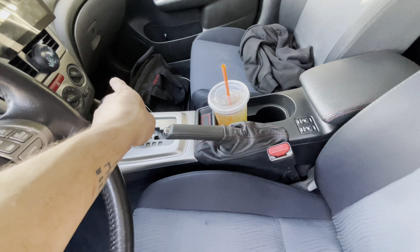I did find the break - it's back here. You can see it's like burnt. I have two halves of the wire; there's one half and that's the other. This is going to be extremely hard to repair. Honestly I can't make any guarantees it's going to work, but I'm going to give it a shot. There is a metal bracket right by where it's all charred - those are literally pieces of the wire - so I don't want to reconnect it and then have an issue, but I'm going to solder it and put some heat shrink on it. Maybe it'll work, maybe it won't.